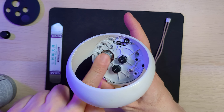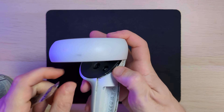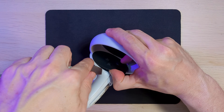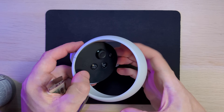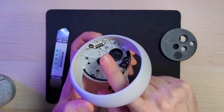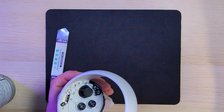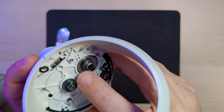I was a little more clued up as to how to get the battery cover off this time - I just went straight in with a separator tool and it was dead easy. I also knew where those clips would be. If you're doing two controllers like I was, it's worth looking at the part you removed from the first controller to figure out where the clips will be on the second. Again, once the battery cover is removed, put your separator tool in the gap, give a wiggle and pop apart that middle one, then work your way around each side - get the separator tool into the gap, give a wiggle, and pop the other two off.